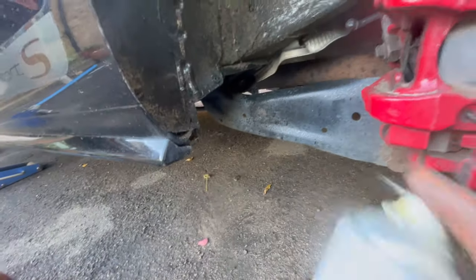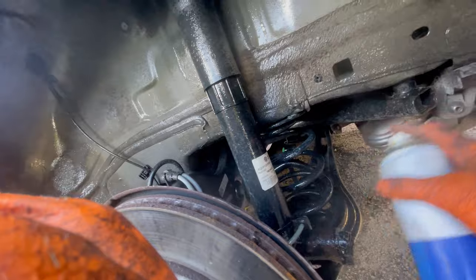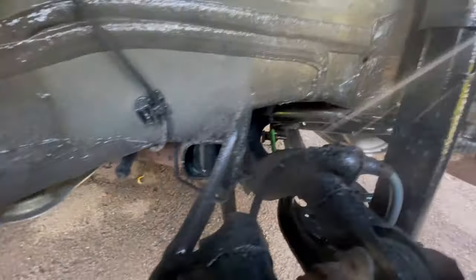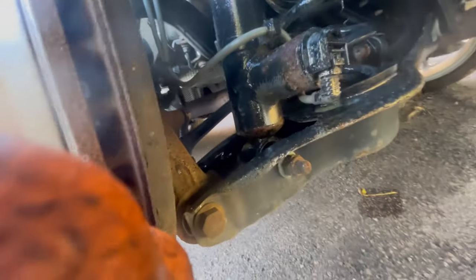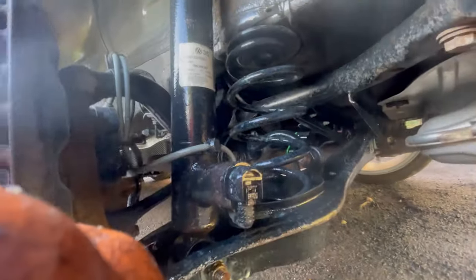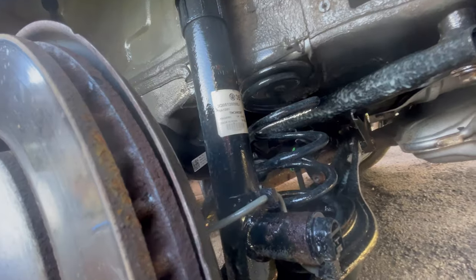This arm here is quite visible and can go a bit brown, so get it on there — doing the inside as well, though I'll do that off camera. It's only the bottom part of the strut we need to worry about. Springs are easy to get all the way around. Anti-roll bar is in there as well. Then these suspension arms, which are really prone to corrosion — particularly on the front, we'll look at that in a sec — but as you can see, really easy to get to and it looks a lot better inside as well. Then the subframe — get as much in there as you can. The exhaust is pretty close but we're not going to spray that close to it; it'll just burn off and may smoke a bit when you warm the car up.